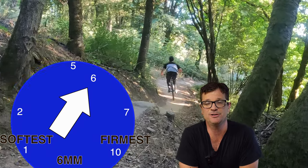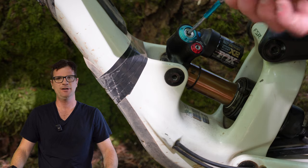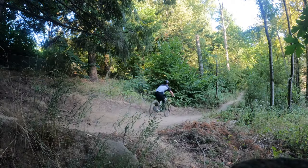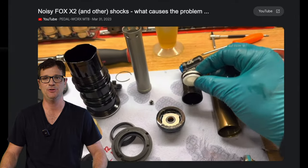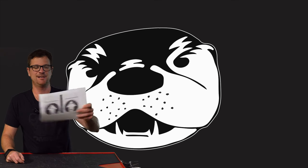Sophisticated suspension can be a blessing and a curse — it's very complex to set up but it rides amazing. The notorious air-in-the-oil happened to my X2 today after casing a jump. Super common problem. Supposedly Fox fixed this issue, but I'm going to send it in and we'll find out. I made some animations and put them in Google Drive — they're in the description below. Print about five of these off and setup will be much easier — you can remember where you are visually.